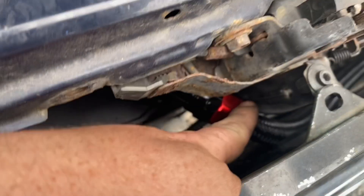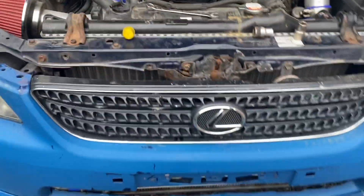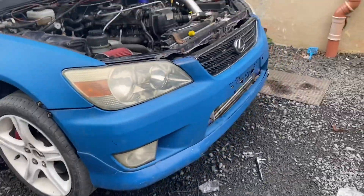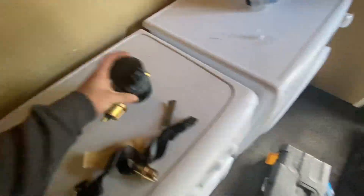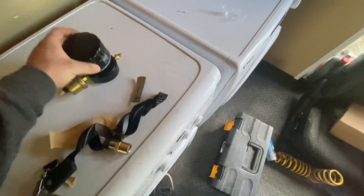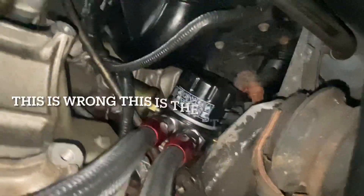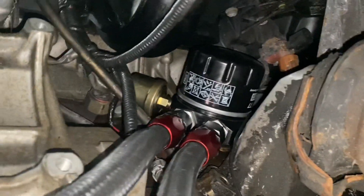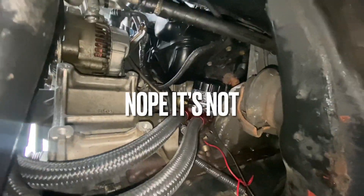This little bracket here, I'm going to notch that out so it sits in a little bit better. It fits — I just want a little bit more space. This is the filter you should get: it's a W77 filter, roughly the size of an actual filter. To make it all fit, all I had to do was hammer the dipstick slightly. Other than that, everything fit.